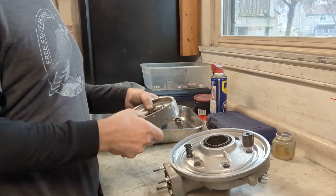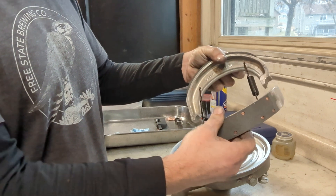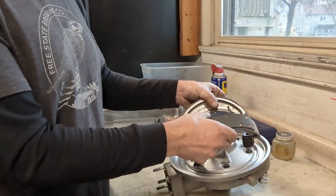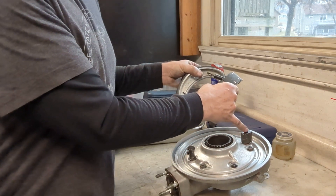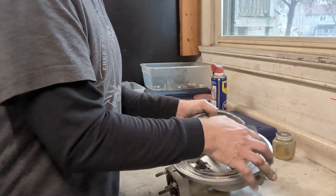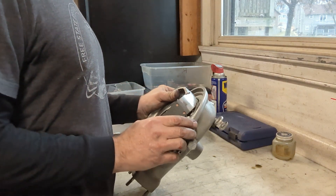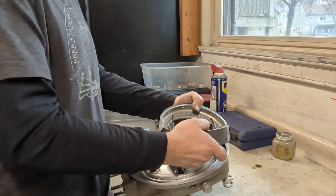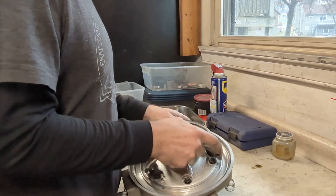We're ready to reinstall the rear shoes now that they've got the new linings on. I've taken the springs and put them over both brake shoes, which is really easy to do at this point. Then we're going to clamshell these onto the rear drive — they fit onto the rear post and onto the brake activator. We'll place them around both of those and then push them down into place. Watch out for the washer. Always wear your safety glasses when working with these springs.